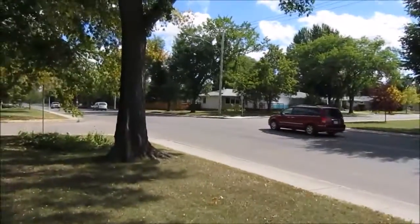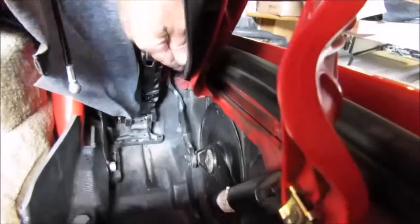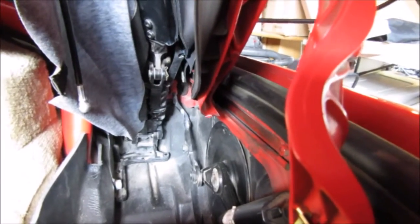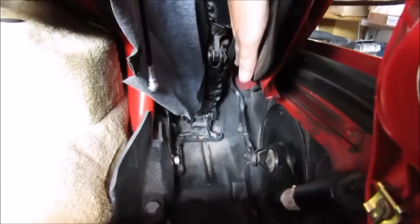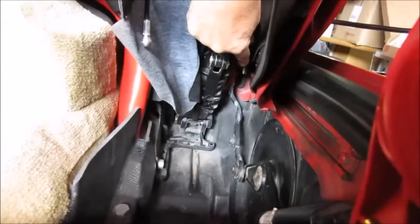This little screw — I'll just put glue, Loctite. Pelican Parts' instructions are very vague on taking those plastic sliders out — they didn't tell you how to get the slider out after removing the two rivets and the screw that holds the cable for the roof. They say it just slides off. Well, it turns out in the back here you have to raise your roof almost closed and then push this up.